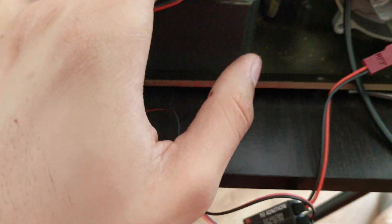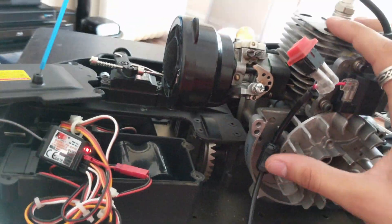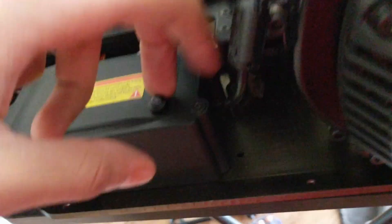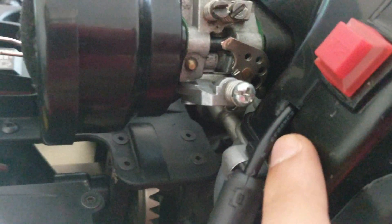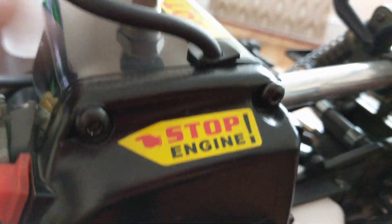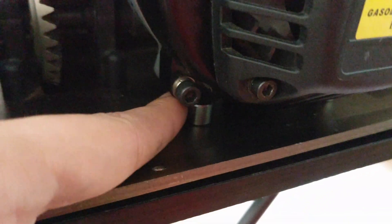That's how you put in a kill switch. After this it's all done and it works fine. You need to make a hole on the top over here for the LED light, and another one so you can pass the wire through. I made the hole with a pocket knife — it works but in the future I'm going to buy something that makes the hole look cleaner. Make sure when you tighten these two connectors you don't over-tighten them, because this part is metal but this part is plastic — you might break the plastic piece. Be careful with that. Put everything on the screws and make sure to put the washer back in.